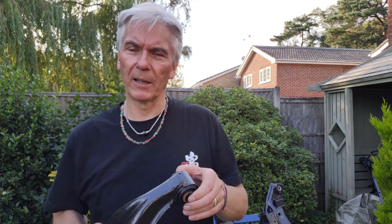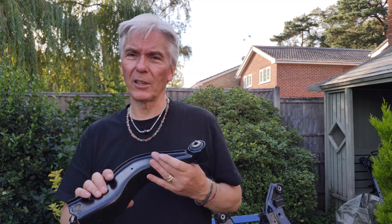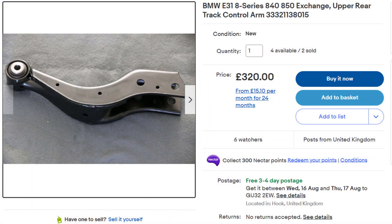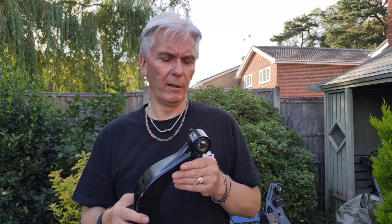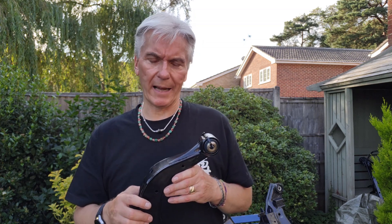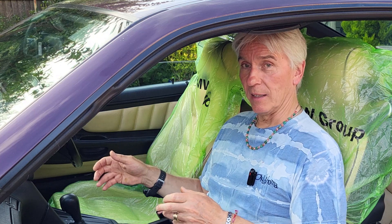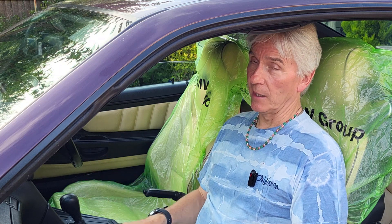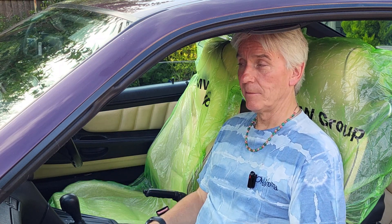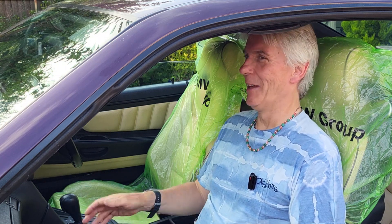The upper wishbones - after I cleared them out there was too much play in them. There we go: nice and shiny new spherical bearings. In England I used Jerry Speechley from Phoenix Motorsport - his name on eBay - and I'll show you the eBay link again. It's not cheap - it's £320 per side - but you do get them powder coated instead of black Hammerite, and the new spherical bearings are very tight in there so they're good. The lower ones I've refurbished myself and they'll have to go to Lee Shannon for him to check. If they're not right I'll send them off to Jerry - £300 per side.